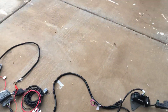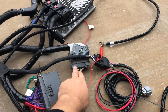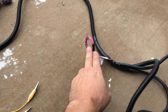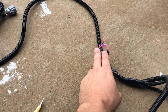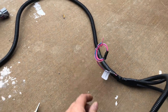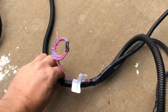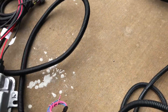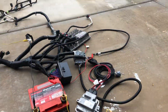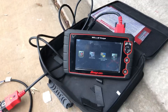First we'll go ahead and turn it on. This is your interior harness — it runs from this area coming to the interior and there's only two wires you hook up, and everything's labeled. 12 volts brakes apply to the blue wire and this is your single ignition turn-on. All right, throttle body came to life. Scanner should connect momentarily.